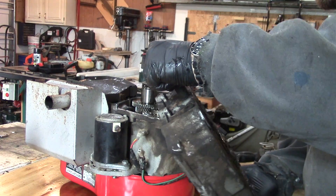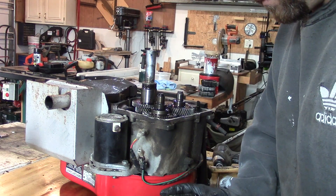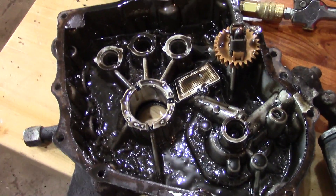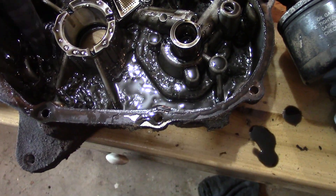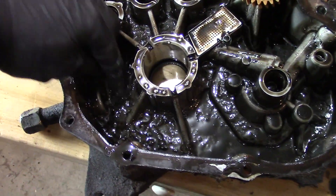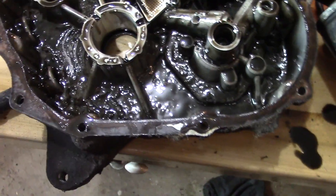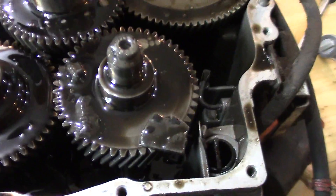Let's see what's going on. There's metal falling out in here. Here's the sump, and this looks like the oil was never changed — this is what they're talking about when they talk about engine sludge, almost like a jelly in there. The good news is the sump looks very good — I don't see any issues with that.